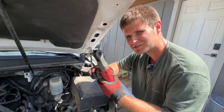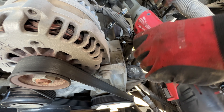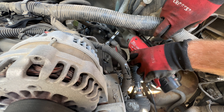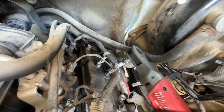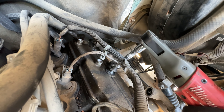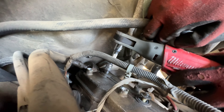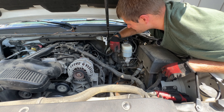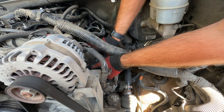Let's get the coil packs off. Reach back here — you don't have any clips on this PCV hose, so just lift up and it will just pop right off, then set it aside. Get a 5/16th — I'm sure that whatever the metric equivalent is, they just happen to be the same size, or Chevy actually uses 5/16ths. All you're going to do is simply buzz these bolts out. The bolts will stay in the valve cover so you don't have to worry about taking them out. Get yourself a set of wobble extensions — these will help you out immensely.